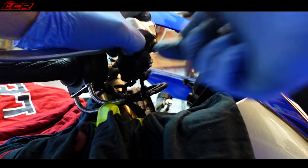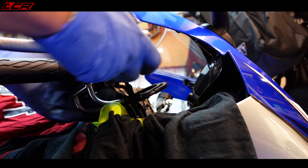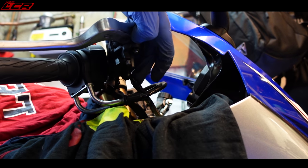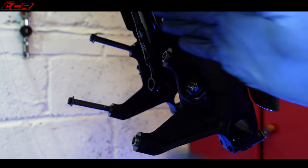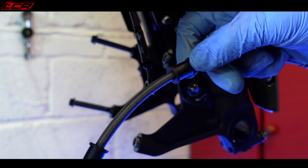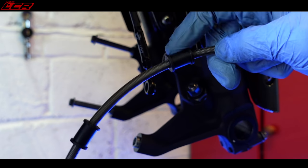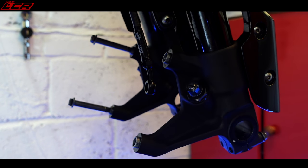I'm not going to tighten anything yet — just going to leave it loose so I can move things into the right positions. The beauty of these lines is they bolt on here so you can move things around a little bit. I've brought the line down here. These little rubbers that come with the cables are guides that go into the mounts — they're really tight. If you spare a little bit of WD-40, you can slide these around because they may not be in exactly the position you need. So use a bit of WD and get it behind, and you can slide those. Line's in place.